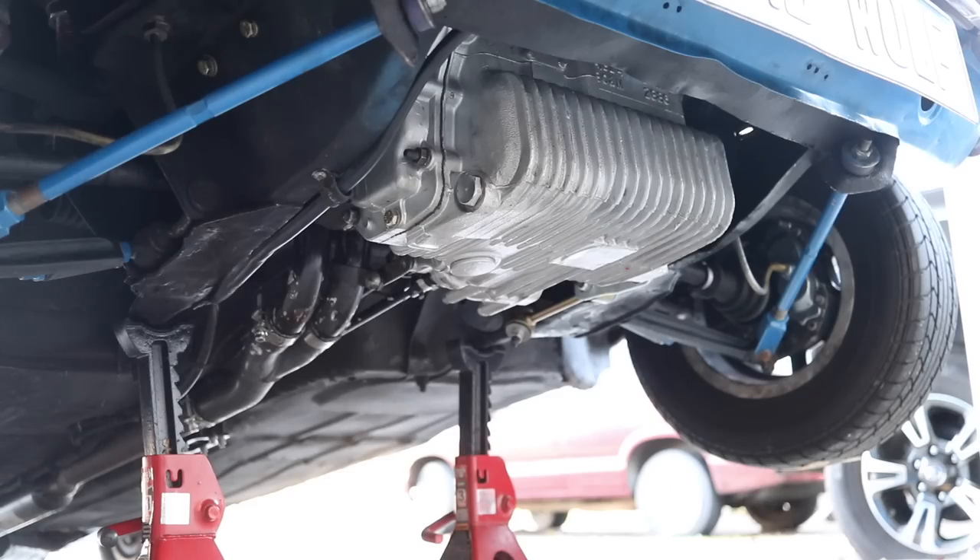Now we're looking at the underside of the front of the car. The first place I like to jack it up from is the connection of the front tie rods to the front of the subframe. That's the most frequent place I jack it from — I've been doing it there for years, basically the whole time I've owned the Mini. That's my favorite place because it's the easiest to get to. Followed closely behind is the bottom portion of the subframe near where the control arms connect up. That part has a little more soft, pliable metal — mine's already kind of wavy in there — and generally I don't lift from there because it has a tendency to warp. When a car is lifted on a full hydraulic lift in a shop, that tends to be the location they use since it's easiest to get the arms into. My two jack stands sit at the back wings of the subframe — that's always where I put them and it keeps the car nice and stable.